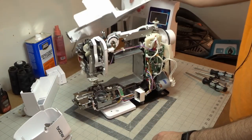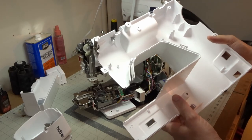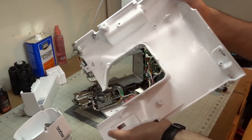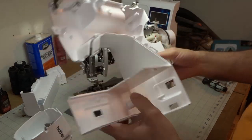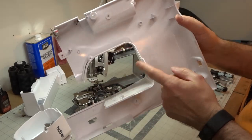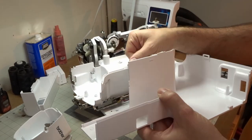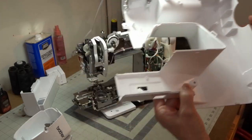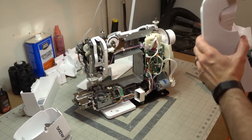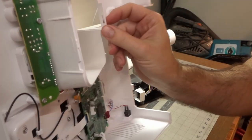The plastic that they're using is just your typical ABS plastic — there's nothing special about it, and this is the same kind of stuff you'll see in all new sewing machines. Brother doesn't always use the clips that make it really hard to pull apart, but on this machine when you pull it apart you end up with little pry marks even using plastic tools. They tend to break — see, that's broken right there, just from taking it apart for maintenance, which you have to do on Brother machines because of the types of bushings they use.